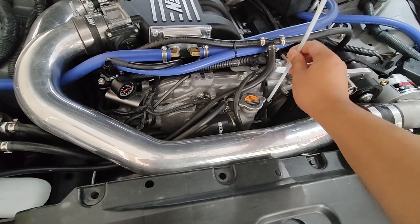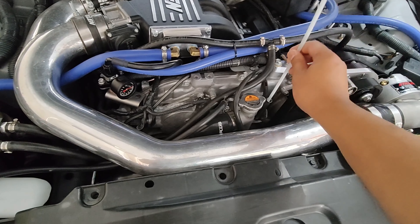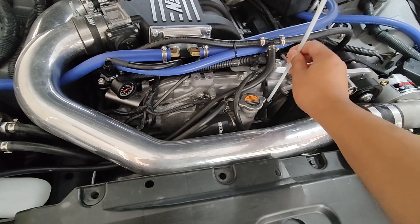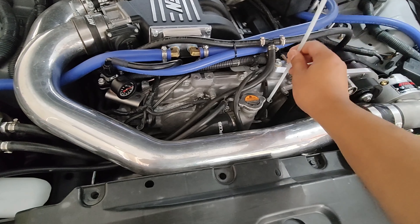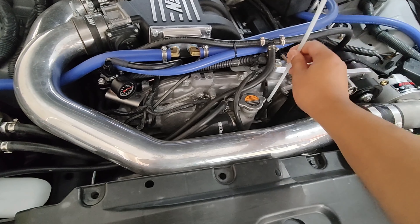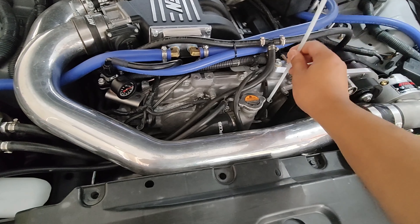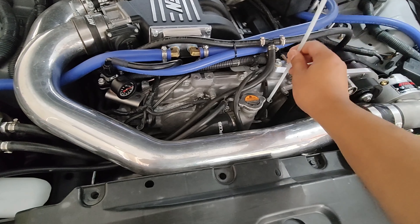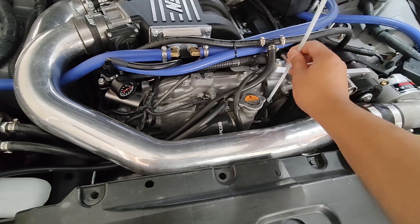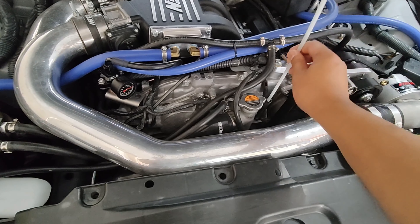So if you purchase a pump with this feature, you want to close this. Let me show you — I'm going to start pumping and you'll start seeing the oil come out. See, there it is right there. You want to pump until it comes into the canister — you can hear it, it sounds like bubble guts. So what you want to do is just let that do its job and do another pump. There's a lot of vacuum in there already. Once it gets a good siphon going it will start coming out of the engine into the pump extractor.